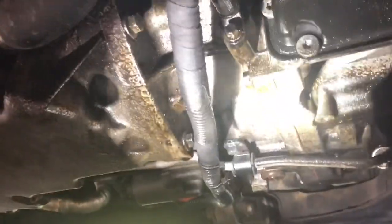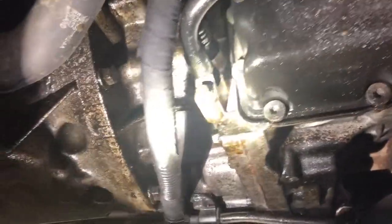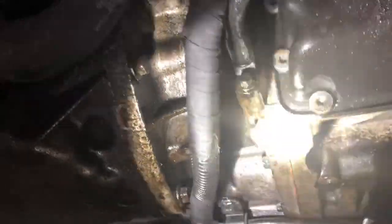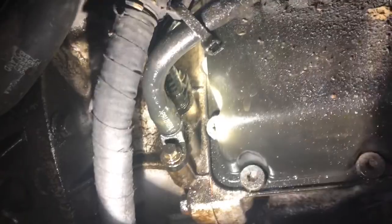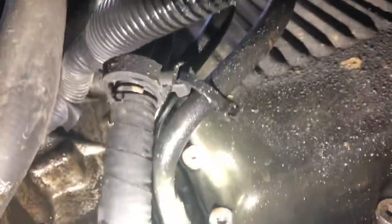I just got the car undersprayed so it's a little more difficult to see where the leak is coming from, but I was seeing traces of it between the transmission and the engine right here. These two pipes here were soaked with oil — those are transmission pipes. This coolant pipe here is all wet with oil, and if you follow the oil upwards it's oily all the way up. We'll go with the premise that the seal is leaking and double-check when I start removing plastic pieces.